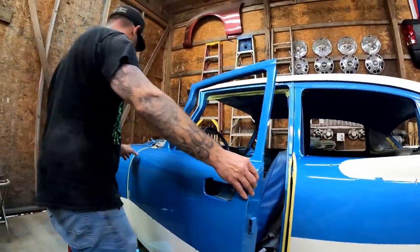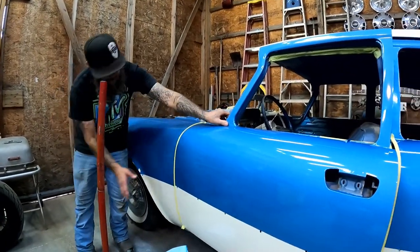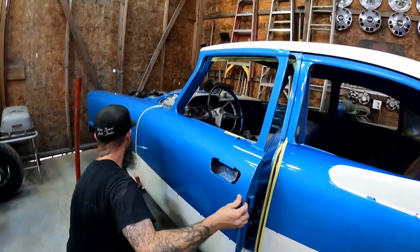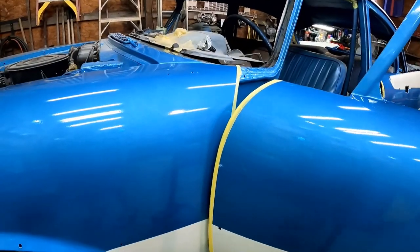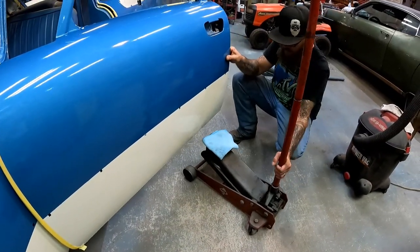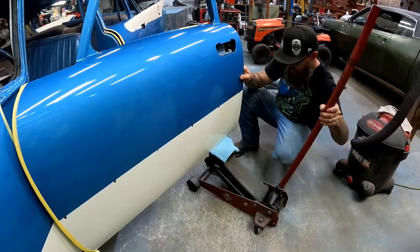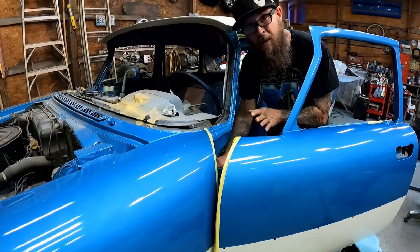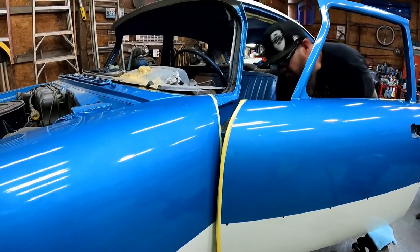Let's see if we're even in the ballpark. The front door is tricky because you're lining up with two panels. I want to make sure we're not gouging in down at the bottom. I think we're going to have to bring the jack toward this end of the door — we'll jack it up. Now I'm going to undo that bottom hinge. Remember we're doing one hinge at a time so we stay locked into position and don't have a door just floating around.